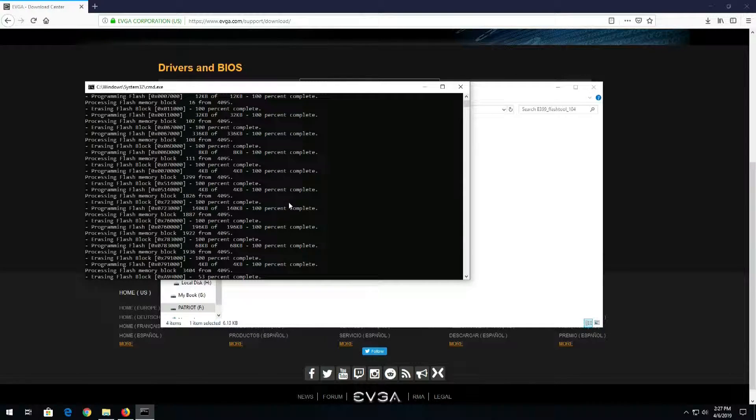This should only take a few seconds. It's great that you can do it from a DOS boot disk - typically nowadays a thumb drive - or straight from Windows. Flashing straight from Windows is always the best way. Just make sure you have any antivirus turned off, because it could interrupt the process.